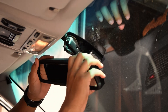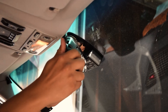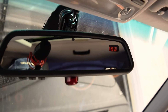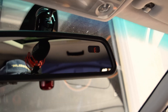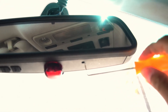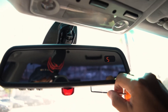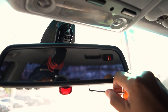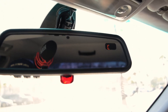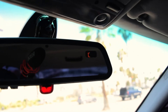Make sure that you lock the mirror all the way to the center position, then let's try the keys. It shows we are due East right now. To calibrate the compass you are going to need some sort of pick tool. Look down under the mirror — there's going to be a little opening. Put your pick tool right there; there's a little button. Press and hold until the letter C appears. Once that happens, you're going to drive in circles, so make sure you're in some sort of open space.